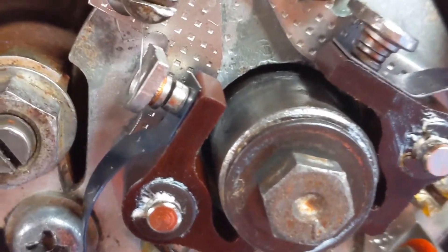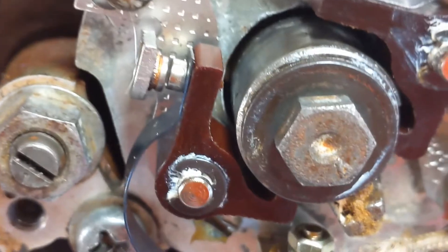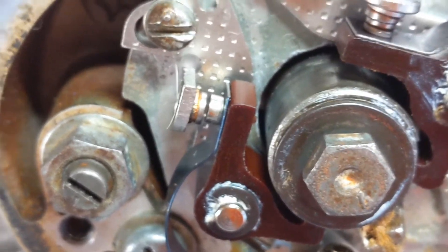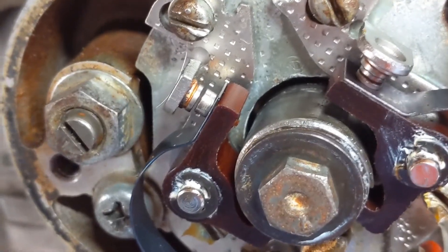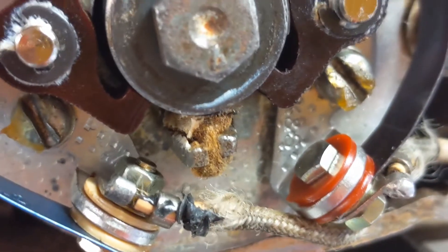The points for the left side are now open to their maximum. I took out my feeler gauge — they're supposed to be between 12 and 16 thousandths, so I go for 14. It's a little bit tight at 14, so I'm going to open it up slightly. To do that you loosen two screws — one of the screws is kind of hard to see, it's buried back in here.